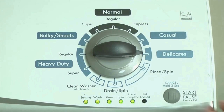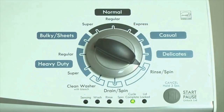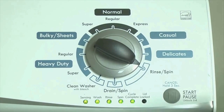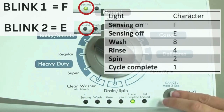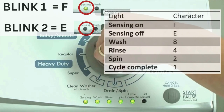If the status lights don't blink, try again and maybe try turning the knob a little faster or slower. Congratulations, now your washer is in diagnostic mode. Now we need to retrieve the codes — follow these steps to display the error code lights. Step 2: Turn the control dial 1 click clockwise, then press the start button. Now you are reading the error codes. The control displays up to 4 error codes. Step 3: Read the error codes.